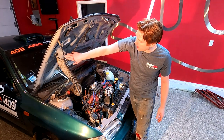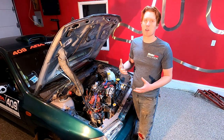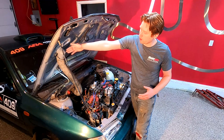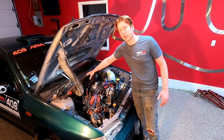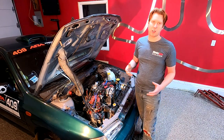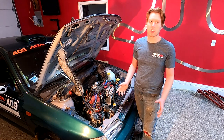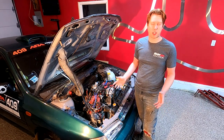So here I've got some water drains and traps so that if it is raining out or I do ingest water through the scoop — this is on a downhill track when the hood is closed — the water will run out and drain into the inner fender area, so I'm not getting all this up in the air filter area. The idea is that you don't have to pull in the service every time and either replace the filter or bead it out or make sure it's not waterlogged. You don't want to have to touch that. And in that respect the stock system is actually best.